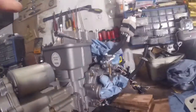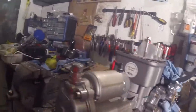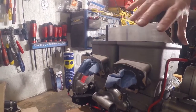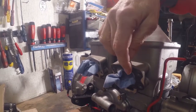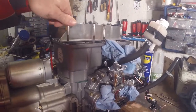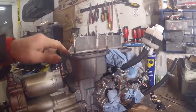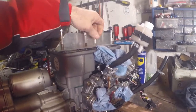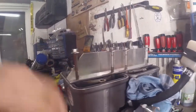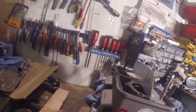The next stage is to take the pots off. David Gore, who built the aircraft originally, advised me that the main thing I need to do is use the exhaust manifold to line up the pots on reassembly, because these pots can twist slightly. So before they're bolted back down, I need to put the manifold on to make sure these faces are completely aligned. I've also seen in the manuals that they use a plate to align the top — David mentioned that wasn't really required, but I thought: well, if I loosen it off and lose the reference, it's gone. So I've made myself a little bracket with four holes in it, which takes a reference off the pots as they are at the moment. The main reference will be bolting on the manifold.